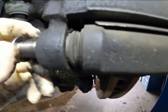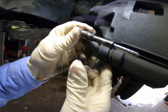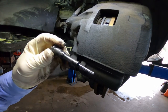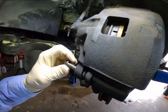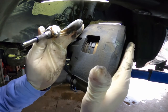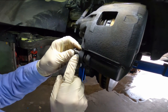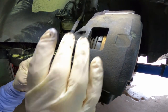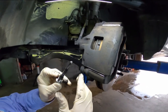A bushing is an o-ring, but when this o-ring gets flat — if you look in this channel here, it gets flat — it allows the caliper to lay up against the pin. This is the leading cause of squeaks on an automobile. Why does it go away when you get new calipers? Because it has a new caliper pin bushing kit in it. There's usually nothing wrong with the hydraulics or the casting, but people replace the whole caliper. The caliper bushing kit costs about three to seven dollars and you can get thirty-five to forty dollars a side to replace them.